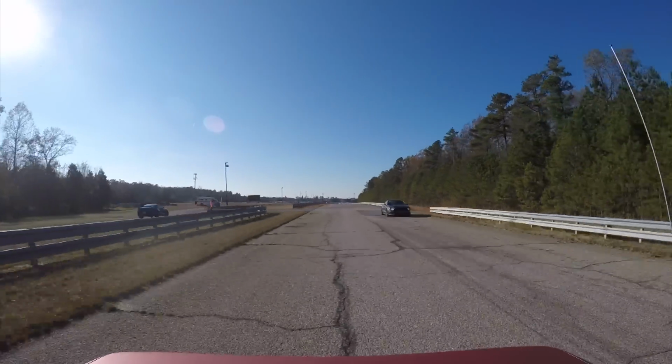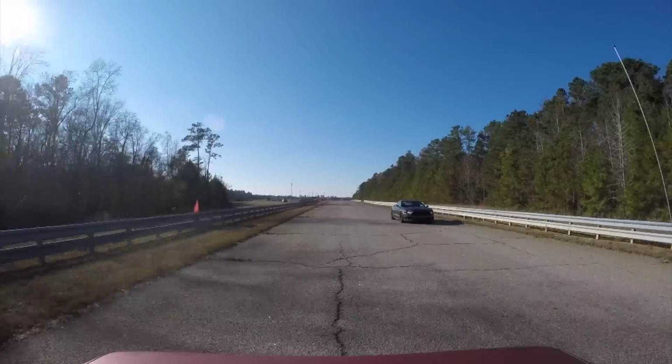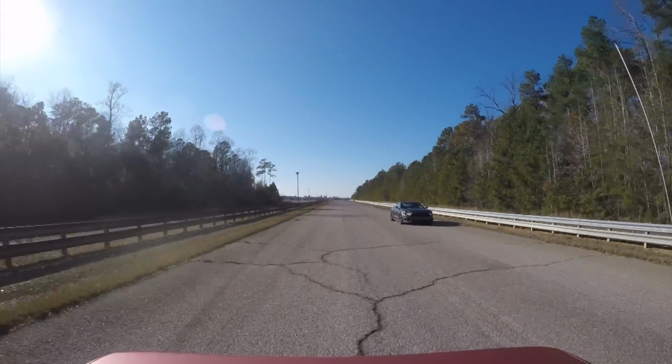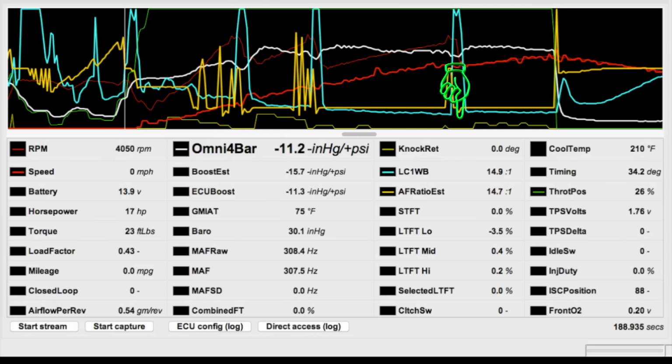Thinking about the spill and being cautious because of the previous spill, I bogged it. Yeah, maybe I should launch at 4,100 RPMs. Anyway, 13.21 ain't too shabby. Also faster than my other gasoline-only pass. Knock is mostly under control in third and fourth, although the last run looked better because of the better air quality. The big water methanol nozzle sent me rich back to 10.5 again.